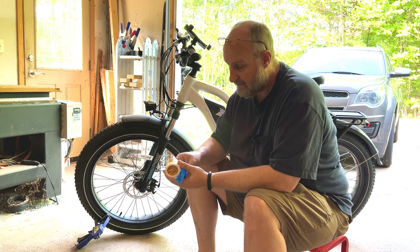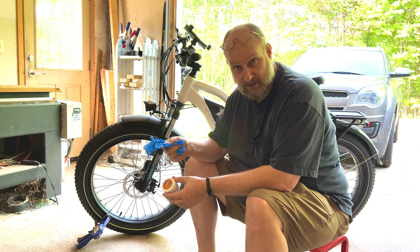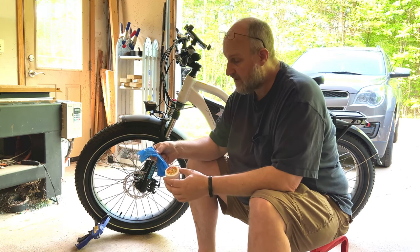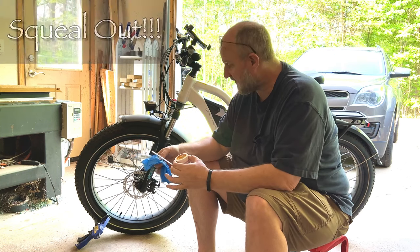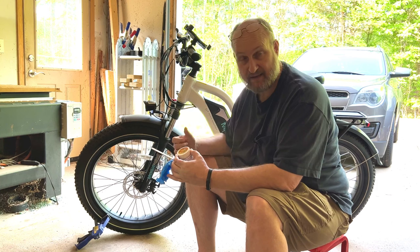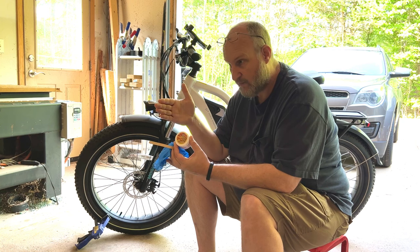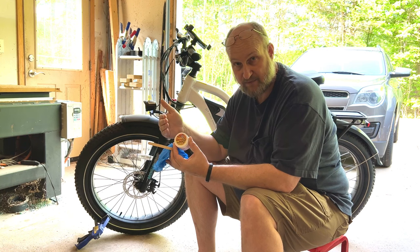What we're going to do: I've got a popsicle stick, I'm going to stir it up really good. I'm going to use gloves because, as I harp on every video, you don't touch the rotor with your fingers. Otherwise the oils on your fingers will get onto the rotor, foul the brake pads, and you'll get noise — which I'm already having. So I've got the Squeak Out, gloves, and a popsicle stick. We're going to apply the paste on both sides of the rotor, take it out, ride it, and keep squeezing the brake until we start getting some bite.